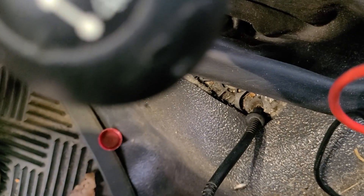I'm going to switch the meter to ohms or buzzer. Black is the chassis ground — right there next to that pin. I'm connected there running the chassis ground check on black, and there's a little bit of resistance but nothing critical — it should be working. That's not good though, because it means I'm pushing power to the radio and the ignition switch signal is there, so the CAN bus should be telling it to turn on. Let me plug it back in.